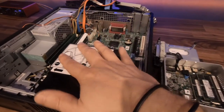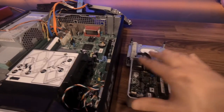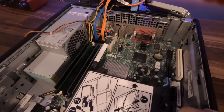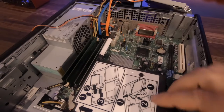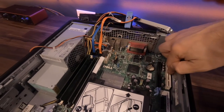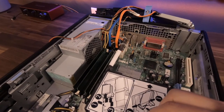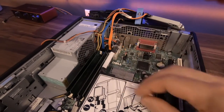This is a custom-built device — you can't really replace the motherboard yourself, but you do have access to the hard drive and the RAM. The motherboard and CPU are built in and more difficult to change because of the size. Generally in people's homes and businesses you're going to find one of these two, or combinations — there could be tower PCs, Intel sticks that are even smaller with even more compact components. Most of the things in here are generally plug and play. Modern versions such as Windows 10 will just pick up hardware changes quite easily — when you replace the RAM, add a hard drive, replace the disk drive, or add additional cards, the BIOS should pick these up, and when you load into Windows it should discover and detect the new devices and install the relevant drivers.